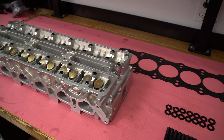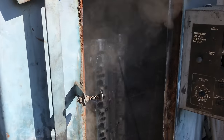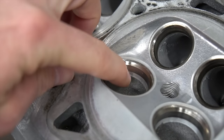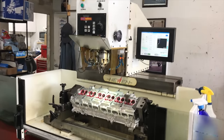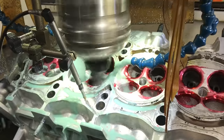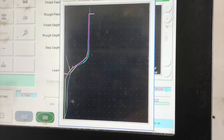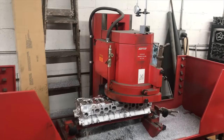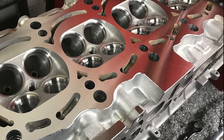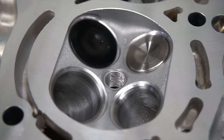Next it's time for the cylinder head. The cylinder head was done by our buddy Tom at Portflow. He took the dirty head, hot tanked it, cleaned it way up. He did what they call a pocket port — the area where the valve seat meets the casting in the head. A lot of the time the factories don't do a very good job of matching it for good flow. A full port and polish I don't believe is necessary on these heads for the power levels we're going to be making. This is a CNC valve cutting machine — you can program it how you want the valve seat cut, and then it goes in and cuts it all perfect. Tom then resurfaced the cylinder head and got it all ready for installation.